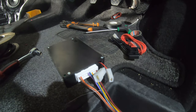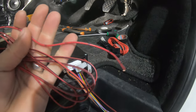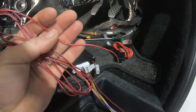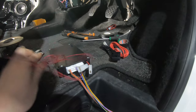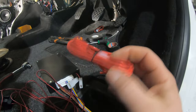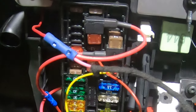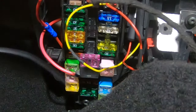There are two live feeds. The live feed in my hand — the red cable with the black line and black dashes — is your ignition feed, so it needs an ignition live feed. It also needs a permanent live feed. What we've done is use the fuse box for both the ignition feed and the permanent feed.